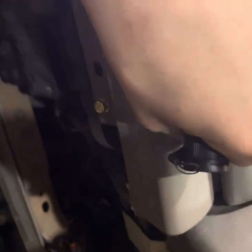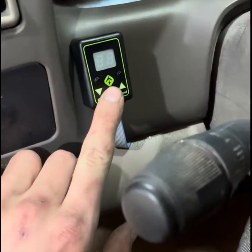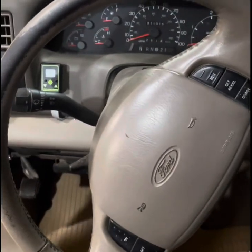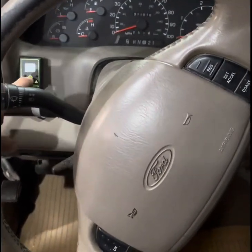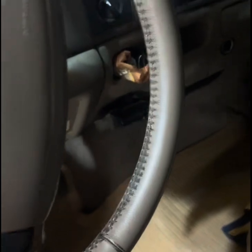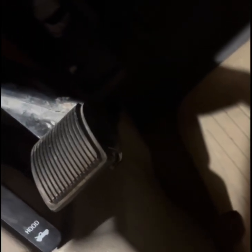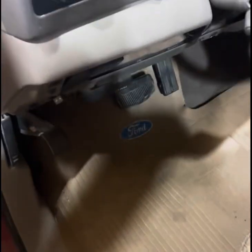I have my ribbon cable here — I ran it up through the dash and have it poking out. Unclip the dash a little bit and I'm going to put my tune selector right here. I decided to put this tune selector on the left-hand side so when you're sitting up in here you can still see what tune you're in and reach over easily. I see a lot of guys tuck it down out of the way, but I think right here is a good location. Double check your 10 millimeter on the firewall, double check both screws holding the PCM in, then reconnect your battery.